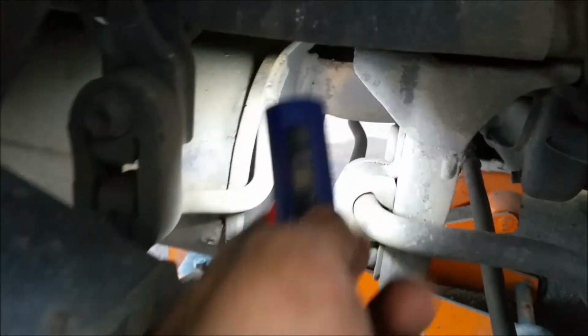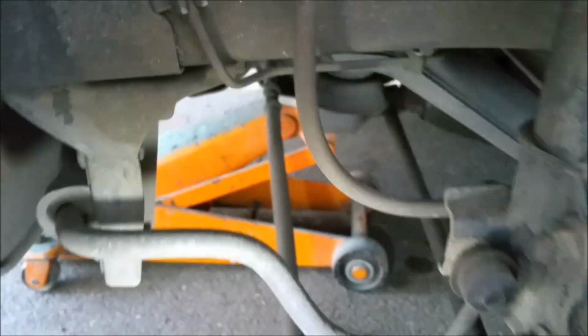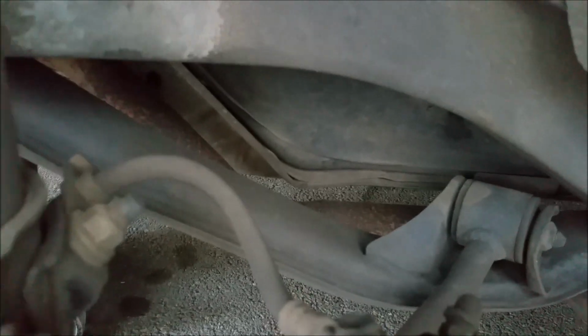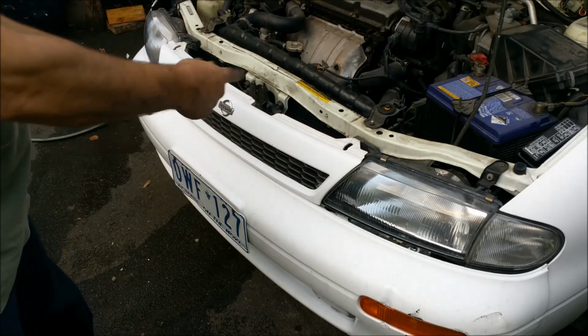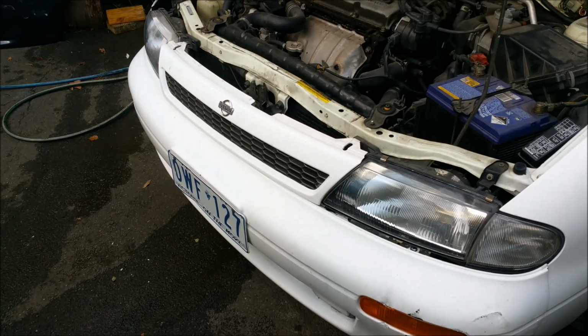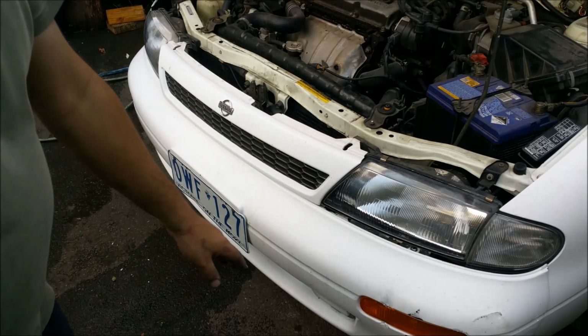So that sway bar bush looks a bit distorted, but most of the problem with this is in the front where the oil's been leaking. So I guess what it translates to is that something like a rocker cover gasket can do a lot of damage. I prefer the Series 2 grill to the Series 1. And the reason for that is in the 90s we sort of had this Unos grill thing with small grills. All Falcons had them and all that sort of thing.